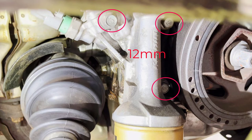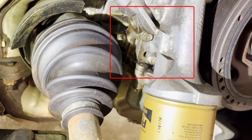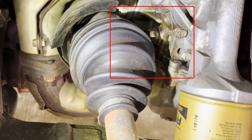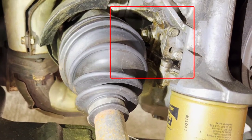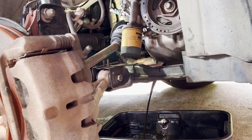Here's the issue: this is the oil filter housing. Those are 12 millimeter bolts. This thing is also called the VTEC, or the variable timing — it has lots of different names. On the 2012 Acura MDX it sits right under the passenger wheel well and it's visible without removing anything except the wheel itself, so we're going to do that in this video. You can see the oil dripping out here, which would definitely be directly responsible for the oil collecting on the oil pan.